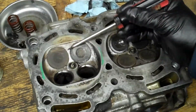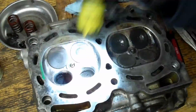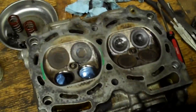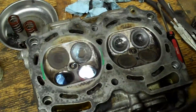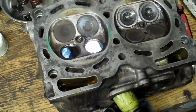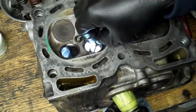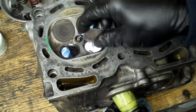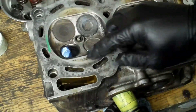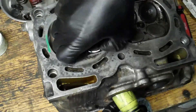If you fail a water test, another thing you can do is the flashlight test. I've got a dark room that's really sealed off, and I stick this flashlight up into the exhaust port. You can see the light coming through here. If you had a crack or a bad valve or it wasn't seating well, you can see that little sliver of light — it'll kind of reveal itself. But only if it's really big.